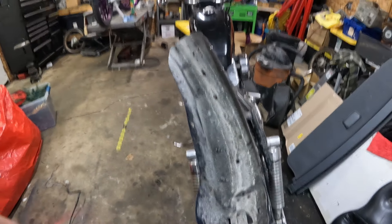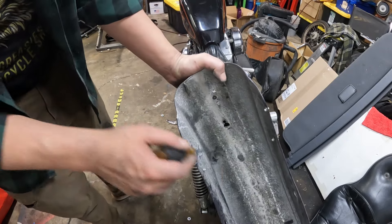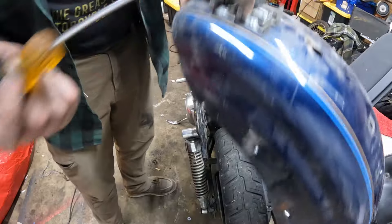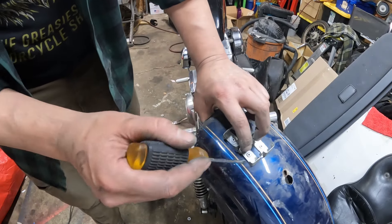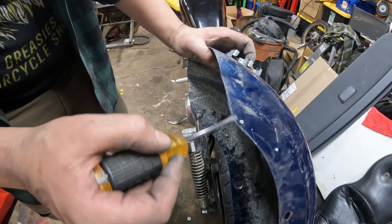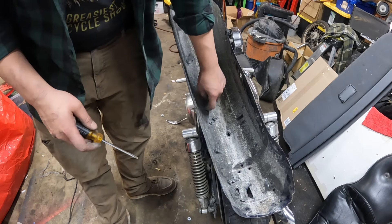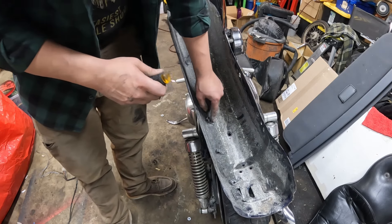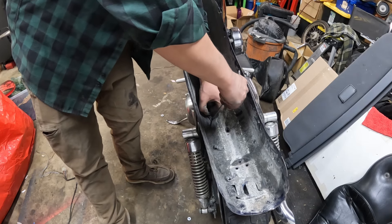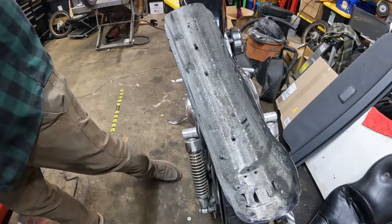Here's where we are now. The wiring loom runs through this, and you have these little pins right here - everything else is riveted, so the circuit breakers are riveted. I probably will drill these out and re-rivet them back in, along with the inner fender. On these little clips - they rotate full 360 in here. Grab a little screwdriver, put it in. You have a fat side and a skinny side. Fat side on this side, skinny side here - jam your screwdriver in, turn the skinny side and pull. Gets it up and they come off just like that. That's your little clip doodads.